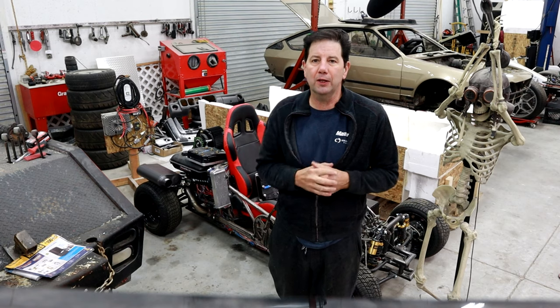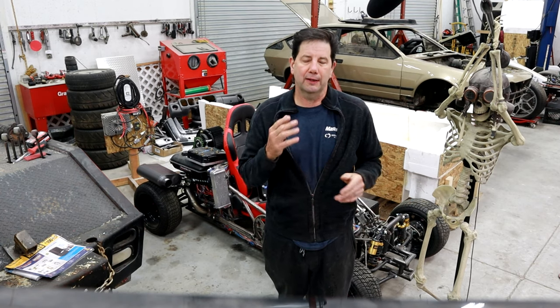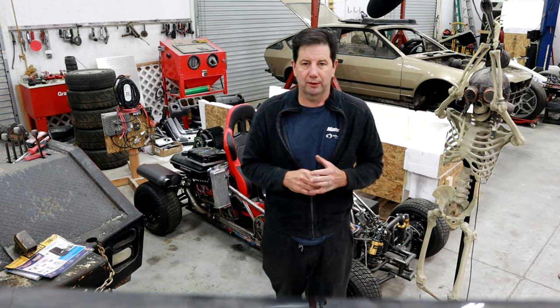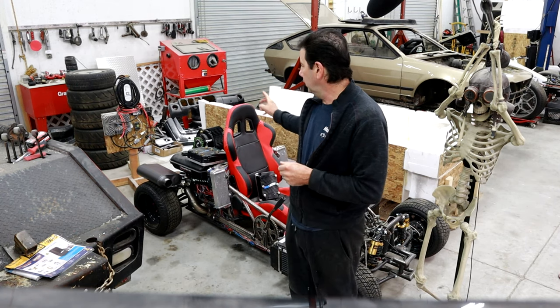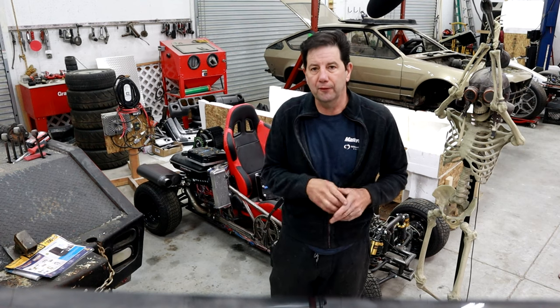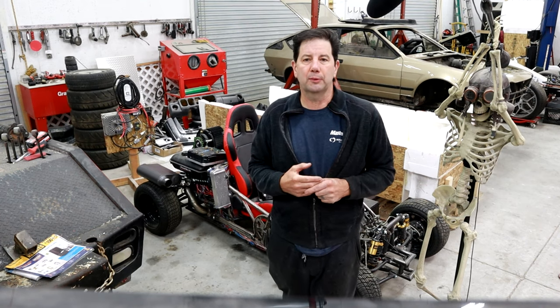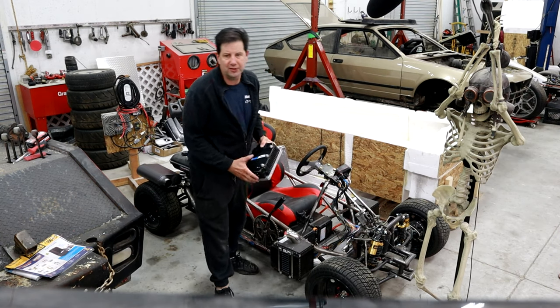In the last video, you heard me mention the cutting out problem where I was running on the cart, and if I gave it full throttle, it was cutting out. Well, that actually was due to an overcurrent, something I did not anticipate. The reason for that is the clutch on the bike is always engaged. That's a wet clutch system and it's spinning. So the faster I go, the more amps it makes it draw, and then I end up with an overcurrent situation.